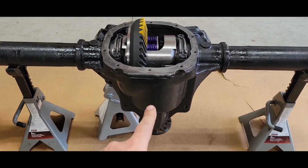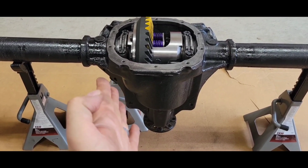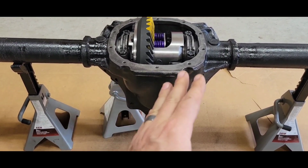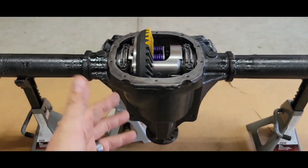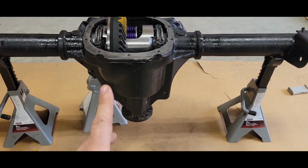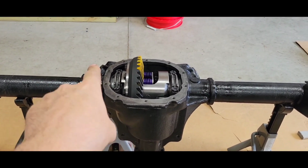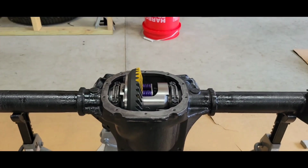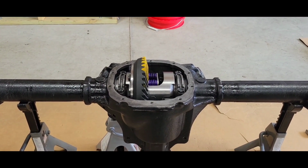You got 2 different bearings I'm gonna have in here. I know their bearings are precise, but they are angular contact, and there is a little bit of tolerance that can stack up and affect your pinion height. You could affect it 5 thousandths, believe it or not. Probably not going to, but when I drop the new bearings in there, I'll take my measurement to the top of the gear again, and I'll know right away if it moved or not. So stay tuned for tomorrow.